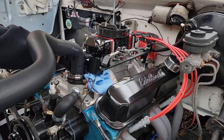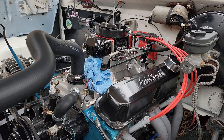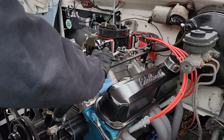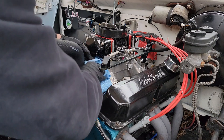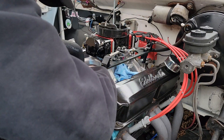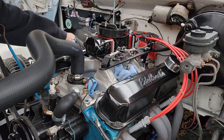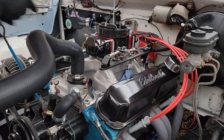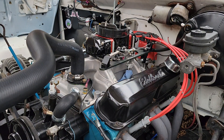Make sure you keep up with your gasket. The theory is once you crack one of these float bowl bolts, you should be able to catch most of the fuel coming out. Try to pick the one that's sitting lowest. Not too bad — just going to dribble some that we can't catch. We caught about half of it, and we can use that to prime the bowls back. That's why you always keep a couple rags handy.